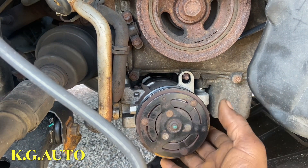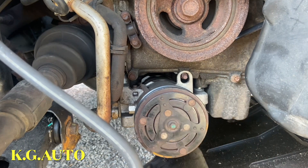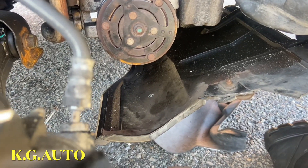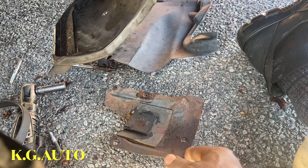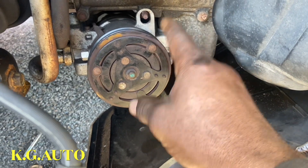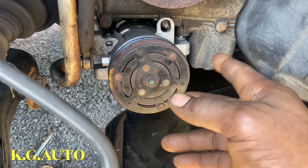So I have to drop the AC. It's just four long bolts. There's a bracket here as well — see this bracket? You have to take off this bracket. Once you take off that bracket, you can drop the whole thing. You still have to force it out — that was the way I got the belt out.